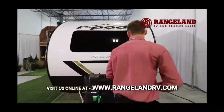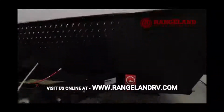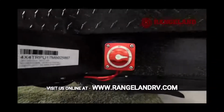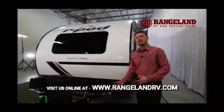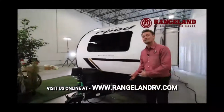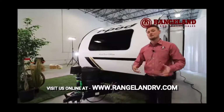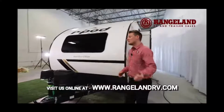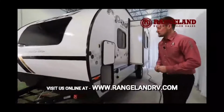Now, speaking of batteries, there is a very cool feature that R-Pod just introduced on their trailers, and that's called the battery disconnect. It's just down on the side here. This is a nice little touch because when you're done using your trailer for the weekend or something like that, you don't necessarily have to pull your batteries off of the trailer. You can hit that switch and it eliminates any kind of draw coming from those batteries. Follow me around this side here and we'll talk about some of the cool features.